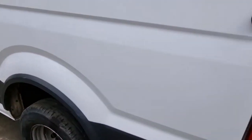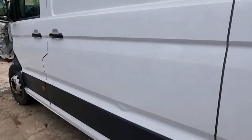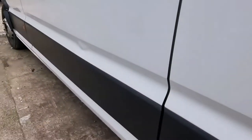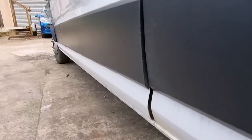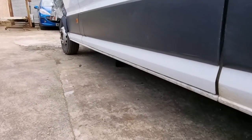Again with the twin wheels this side. This rear quarter is actually nice and straight, but where somebody's taken the stickers off they've actually cut them and scored the paint — actually quite deep in places. That will have to be painted, although it doesn't need any filler. The sliding door has a dent there. Other than that it's fairly straight, though the bottom end does stick out slightly. Whether that's something to do with the dent I don't know — we'll straighten the dent out and see if that kicks in. The sill looks nice, so I don't think it's hit anything major.